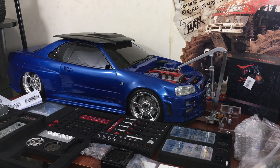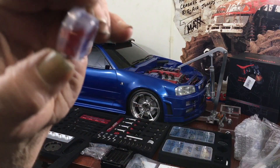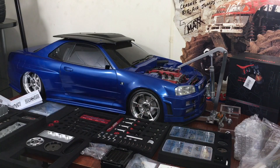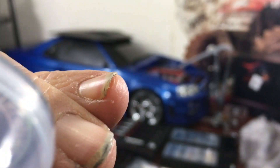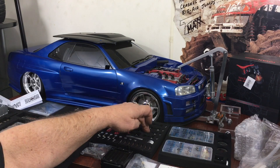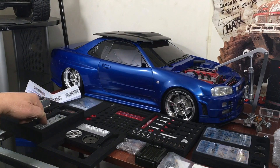Don't be afraid of using grease — you get a little bit with the engine, which is almost enough to put everything together lightly. Also, this here is Loctite, but there's hardly any in there. When I put my rods together I use blue Loctite so you can remove it if needed. Loctite all the rod bolts or screws, and also the rocker arm brackets on top of the cylinder head — they do back off.